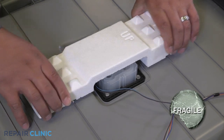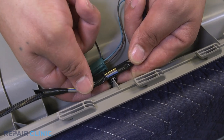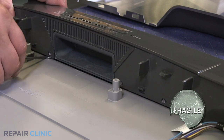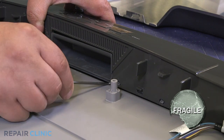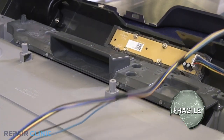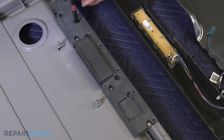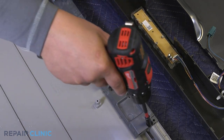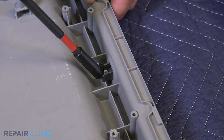Slide the inner door up to remove it and place aside. Pull off the foam block. Unplug the wire harness and unclip it from the inner door. Using the 90-degree pick, pry the control assembly off the four tabs and pull it aside. Unthread the four quarter inch screws securing the pocket handle and remove it. Unscrew the quarter inch screw on the latch striker and pull out the striker.